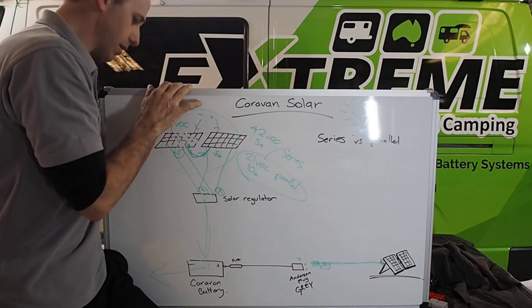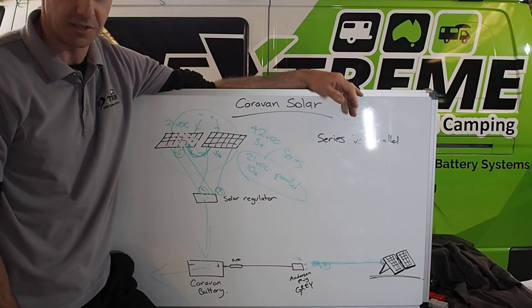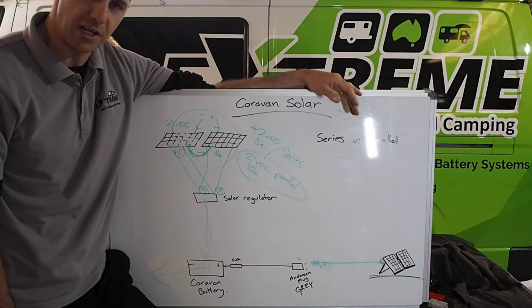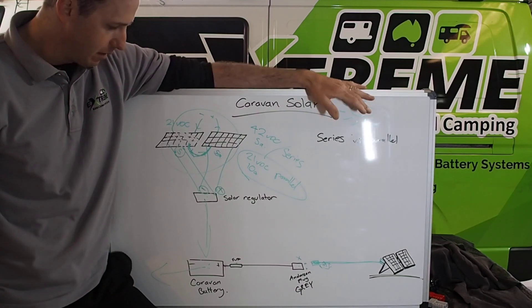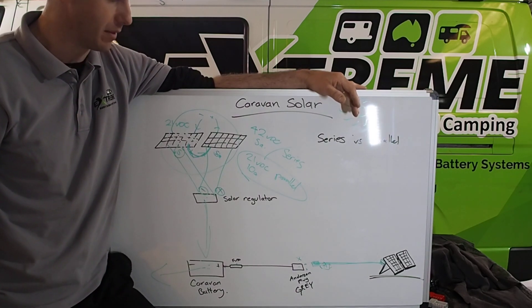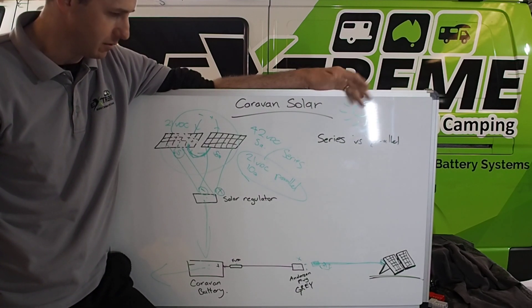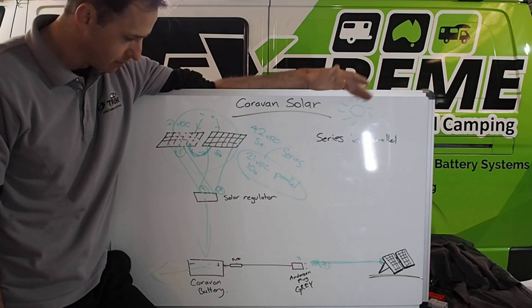Every caravan roof is different. I'll get a van where there's nothing on the roof and I can put three panels in series, and you'll get way more power — the gauge of the cable can be 6mm and I'll get zero volt drop, probably talking 60 volts coming down. If there's no shade, that's fine. But if there's a possibility of any shade, I'll look at parallel instead. Most caravans — I'll say most — are done in parallel, and most of what I do is parallel. But you'll get big motorhomes with 10 or 12 panels where you have no choice but to string them up in series.